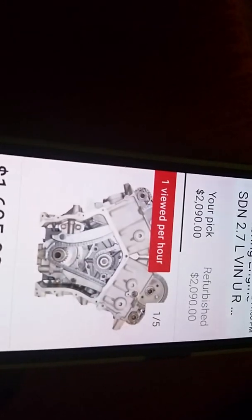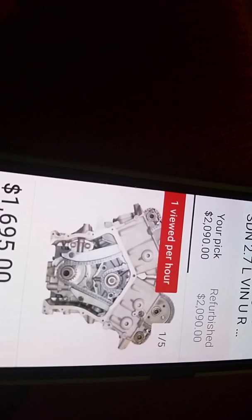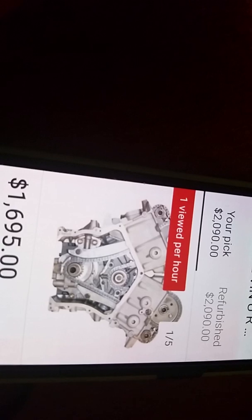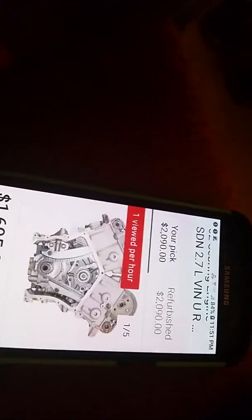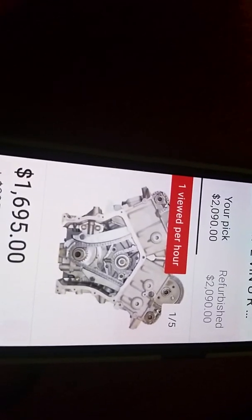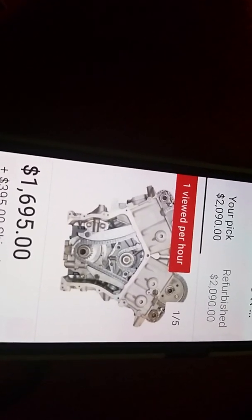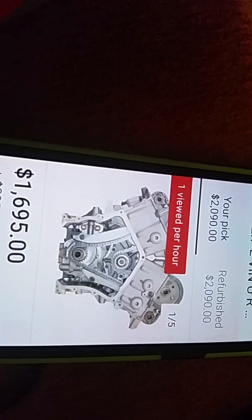The Hellcats all use 0W40. And now even Mercedes-Benz, which was using 10W60, went back to 0W40 per a technical service bulletin for some of their high-performance vehicles because rod and main bearings were starting to fail — the oil was too thick for the tight tolerances.